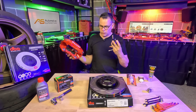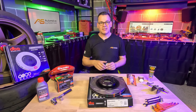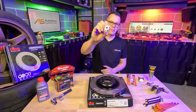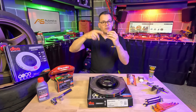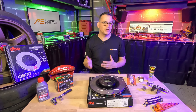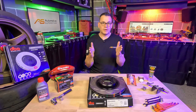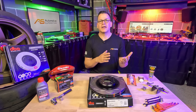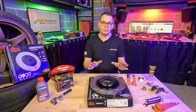On my Audi, the rear calipers are single piston and need to be rotated to move back into the caliper. For that I've got a tool from our website with different types of pins — you put a socket into it, insert it into the piston, and rotate to push the piston back in. There are also electronic handbrake pistons which are more tricky. On certain vehicles you can control that from the steering wheel and set the car into a servicing mode to retract the pistons. Other cars — certain late-model Volkswagen/Audi vehicles — require a diagnostics tool to enter that service mode.